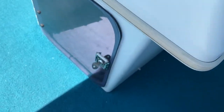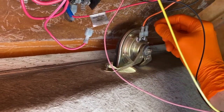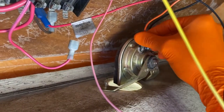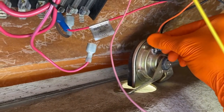Next thing we'll do is go down below where all of our fuses are, which are way up under there. Down below here is our horn — verify the connection points are secured on the leads. You can even pull them off and verify that there is no rust or corrosion interfering with the electrical connection.